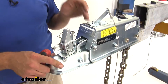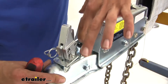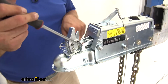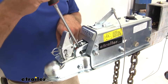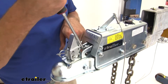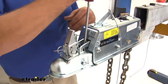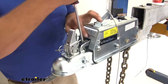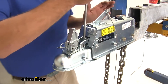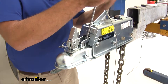Something I like about this coupler is right here you can see the head of a screw or bolt that comes out with a lock nut on it. Simply by using a screwdriver, we're able to go to the hole in the coupler and use that to pump our fluid. That's going to generate the pressure we need to get our fluid all the way back through our lines. We'll pump it up a little bit just to get everything primed, then have somebody hold this, and as they're holding it we're going to open up our bleeder screws and start letting air out of the system.